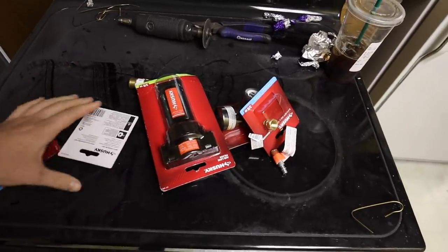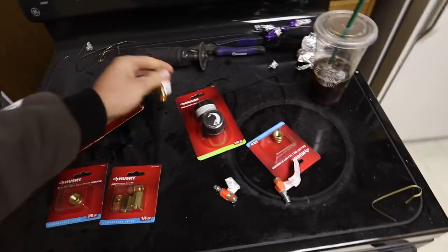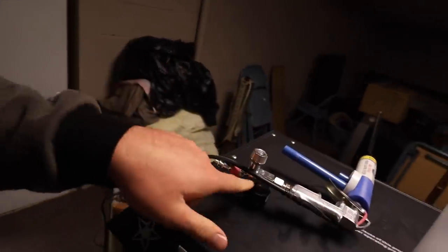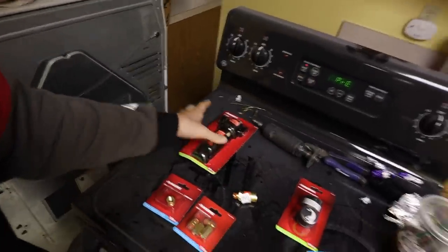So we went to Home Depot yesterday and picked up a water trap and a bunch of various fittings. The fittings are gonna allow me to put it on that compressor and take it out to my blue compressor, and switch it to whatever big compressor I get in the future. I've noticed when shooting powder on the smaller objects it feels not right — I didn't realize I bought an airflow gauge instead of a regulator. I'm gonna swap those out so I can run the compressor at 100 psi but dumb it down to about 5 psi. Out of the compressor we're gonna have a water trap so no water gets into our powder, giving us a better spray and making sure the powder isn't getting any moisture in it.